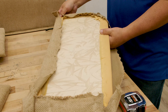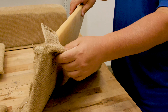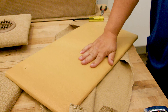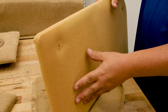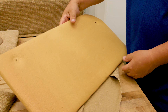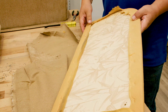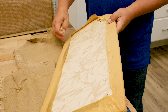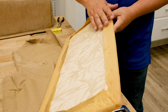We have all the staples removed and that does take some time. Let's take a look at the foam. Now it's true that nobody really touches this foam — it's not compressed in any way because it's basically never been compressed much from occupants sitting on it. So I think I'm just going to leave it on. If I were going to replace it or if it were in bad shape, I would replace it with a half inch sew foam and wrap it around.